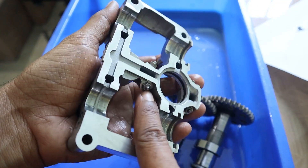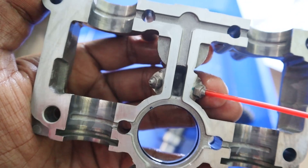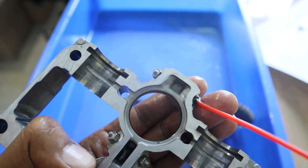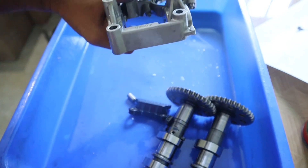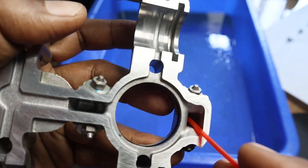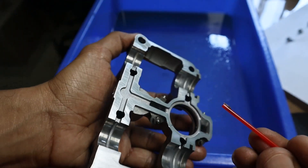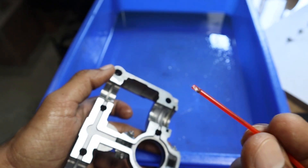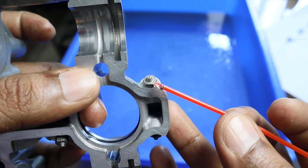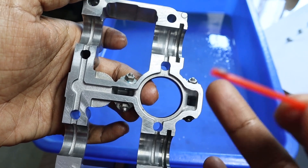Once these are cleaned, we also clean the jets by reverse spraying them. After backflushing the jets, there is one small particle inside which has been deposited. If left as it is, this could definitely clog the jet over time. Hence it is very important to clean these jets — if they are blocked, there won't be oil circulation onto the valve springs, which could cause major damage.